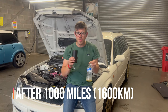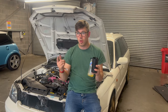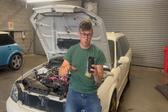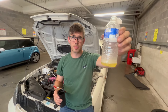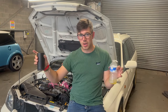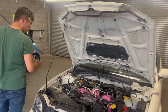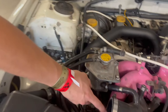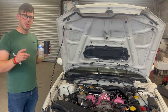I'm going to put a couple of hundred miles on it, check the oil again — say a tank of fuel, about 250-260 miles — and then we'll see how much oil is in the catch can. So the catch can was installed and I've done about 1,000 road miles. Just emptied it all — and as you can hear, we're back at Donington to do some more laps. Just put fresh oil in, so that's all clean and we should be able to see if it's any different. If you want to come closer — we've got this. It looks like sunflower oil. I'm not entirely sure what that is or if it's supposed to be that colour, but that's what was in there after 1,000 miles and about five quickish laps. No smoke and no oil on the last video, and no oil coming out here or in the air filter either. So we'll go back out on track and see what it does.